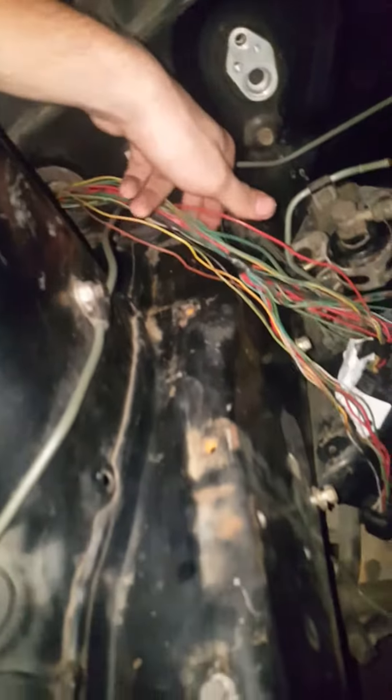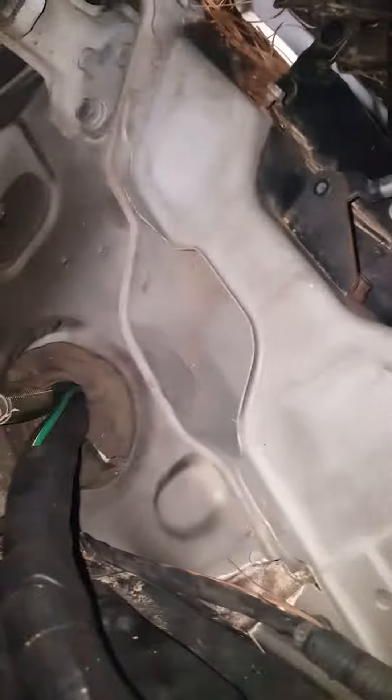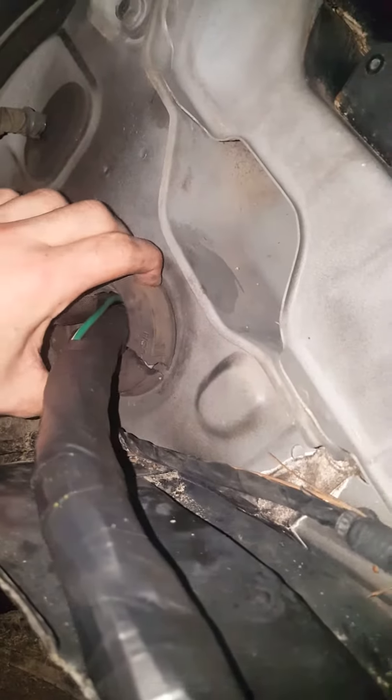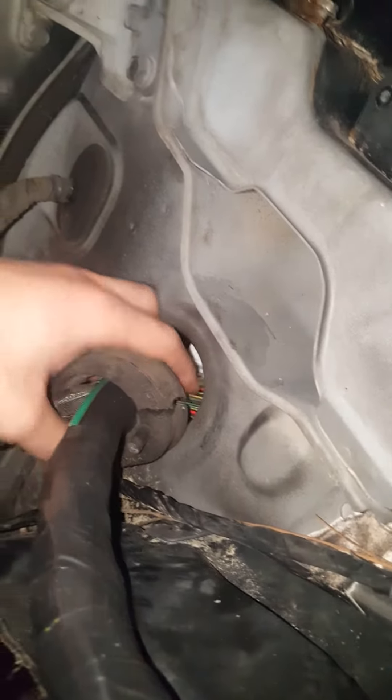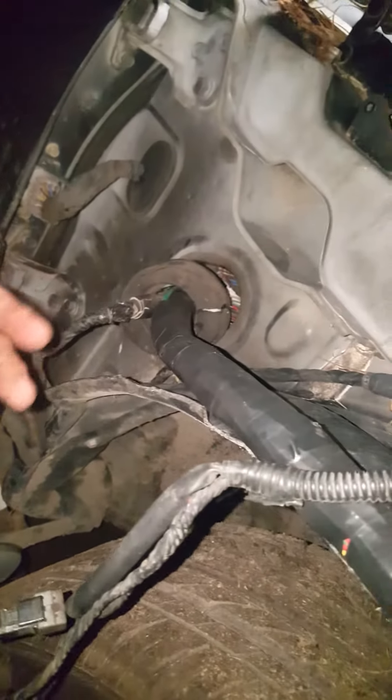Normally you'd have the wiring harness coming through right here at the firewall, and as it's running along you just grab it — it comes out as one big harness. You have one connector on the firewall you have to undo, and pretty much after you get it pulled, make a little angle with the harness itself, bend it back, and try to get the whole entire harness out over here on the passenger side.